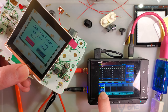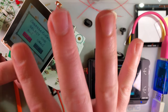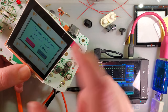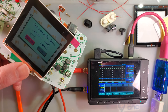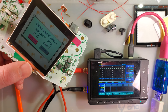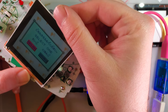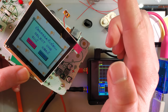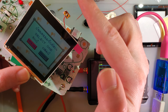Comes on, and we are pulling 194 to 236 milliamps. So, four times as much. Nice. That is brightness. I think we might be better off to test this later. Brightness at the minimum level, we have 193 to 222. 189 to 222. And we have 1, 2, 3, 4, 5, 6, 7, 8, 9, 10. Or was that 10? That was probably 10.